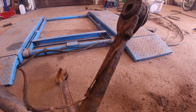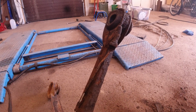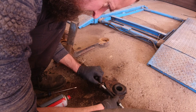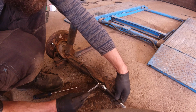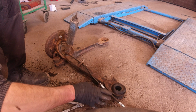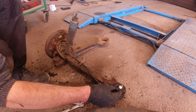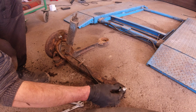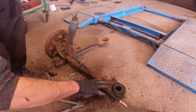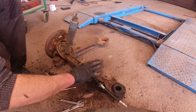So yeah. And while being in here, it seems to be a very good idea to change the brake line and take this apart and put the new brake hose on it before putting it back together, because it's so much easier right now. Well, this actually turned out to be wrong, because, well, it's the right combination and so on, but this one should be put onto the pressure divider in the middle of the car before, and that seems to be in a very difficult position, so I think I'm gonna take the other side off now and then have a bit more access to take that point out and then fit everything back together.